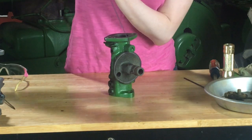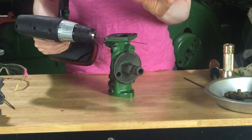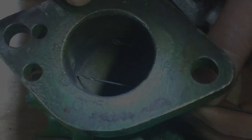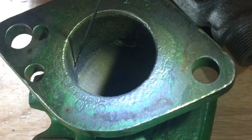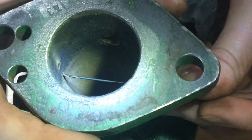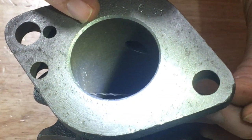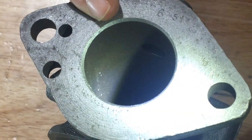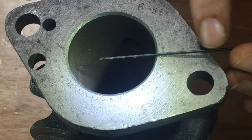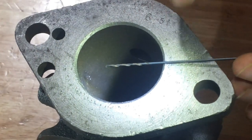Next we'll clean the idle path which goes all the way down to the idle needle. It's absolutely essential that you use the right size drill bit — this is a number 53 drill bit which is 0.059 inch size. You absolutely need to clean out this passageway for your idle. On the throttle side of the carburetor there are two orifices: you'll clean one from the top on an angle and the second from the bottom. This is an all-fuel carburetor; if you have a gas-only carburetor, it's slightly different — there are four smaller orifices. This is a number 57 drill bit which is 0.043 inches. Normally these get plugged due to rust, so just soaking the carburetor won't work — you need to drill them out.